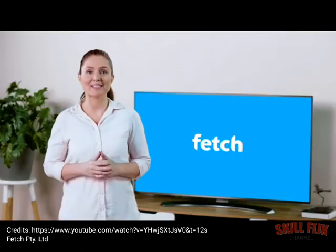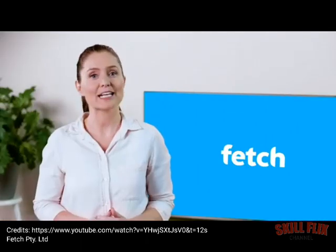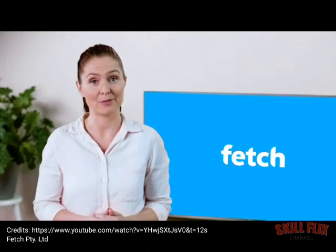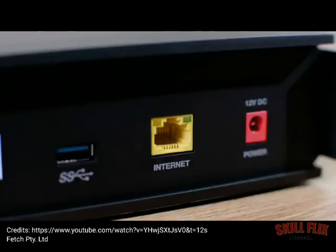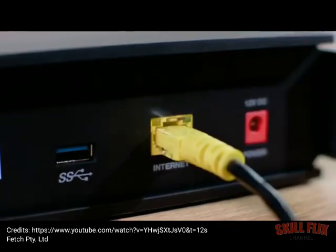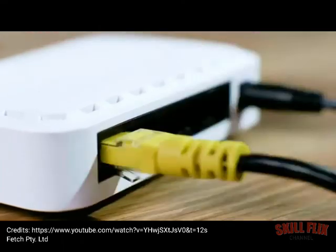Now I'll show you how to set up your box using an Ethernet connection. If you're going to connect via Wi-Fi, you can skip this step and we'll run through wireless setup later in this video. For an Ethernet connection, simply plug the Ethernet cable into the yellow internet port on the back of your set-top box and the other end into your modem.